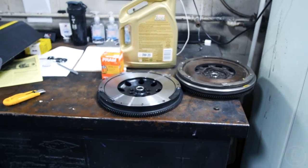The release point on the clutch is super high — it's near the top of the clutch pedal so that was something to get used to. But I think what really transformed this car was the flywheel. The OEM flywheel is about 32 pounds and we cut it in half to about 17.5 pounds, and that really eliminates that rev hang that a lot of us hate. It does take a bit of getting used to because I was so used to lazy shifting around the city, so a lot of my shifts with this new clutch were getting questionable. The revs drop very very fast, which I really like.